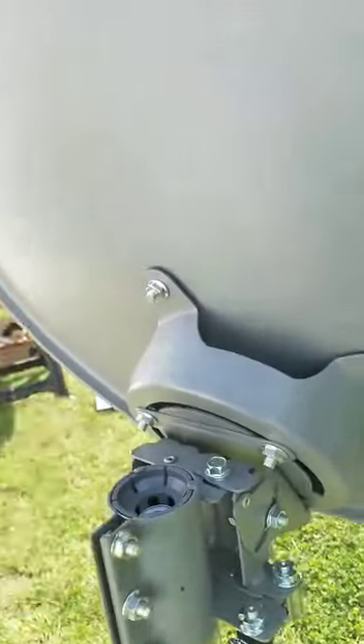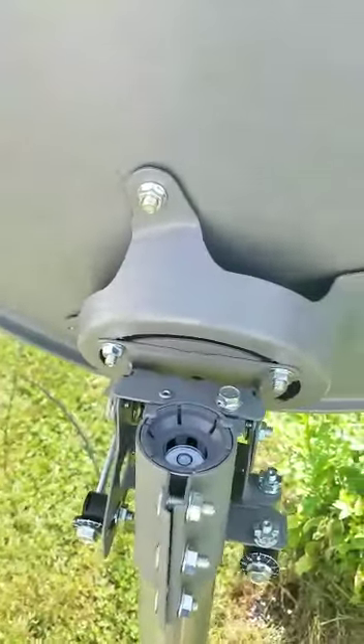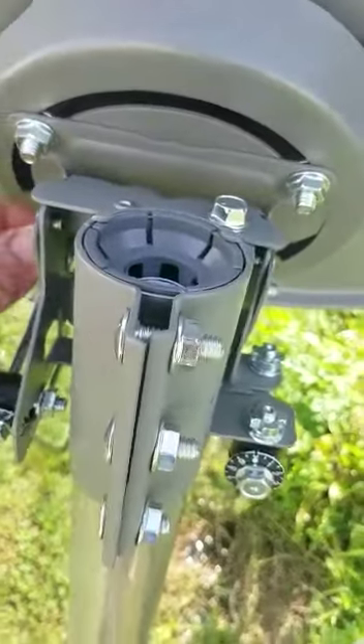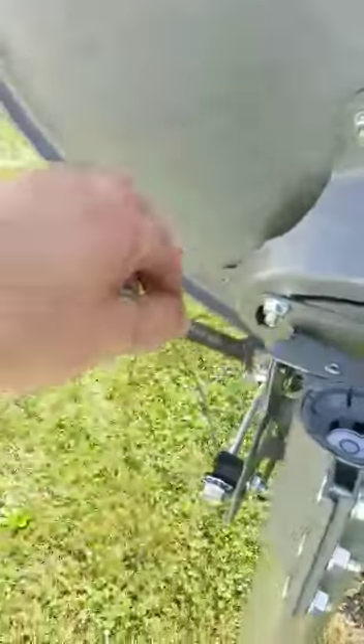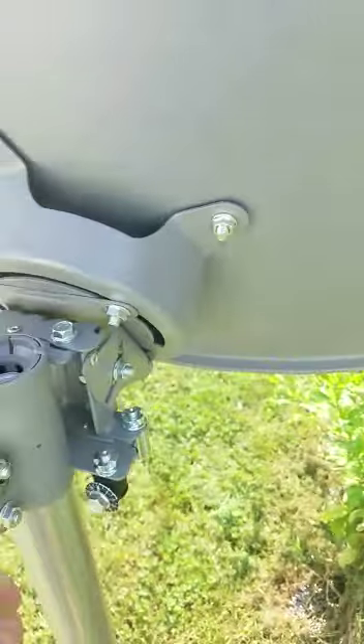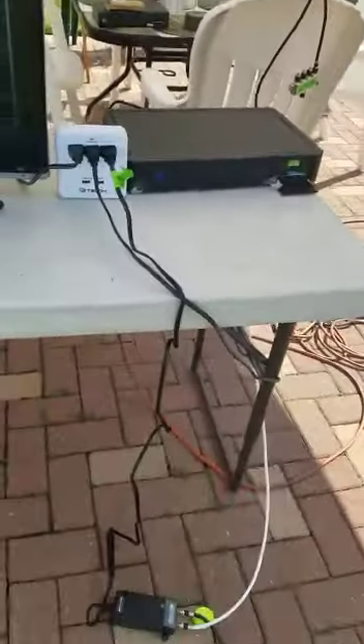Go back to the satellite and attach the two remaining bolts — left and right. I got a signal right there. Just move it, attach this one and this one. If you have satellite 101 at 97 but another satellite port's signal is low, first move the dish up and down to optimize. You also have the option to adjust left, right, up, and down. Once you have a great signal on all satellites, make sure everything is attached and hit Done.